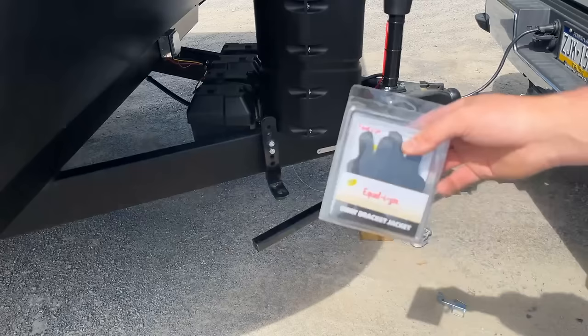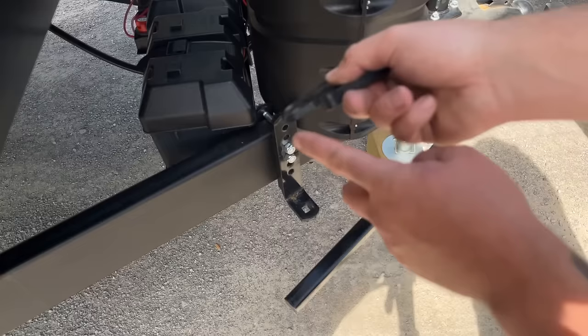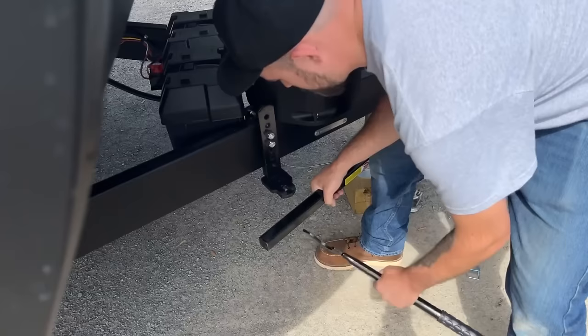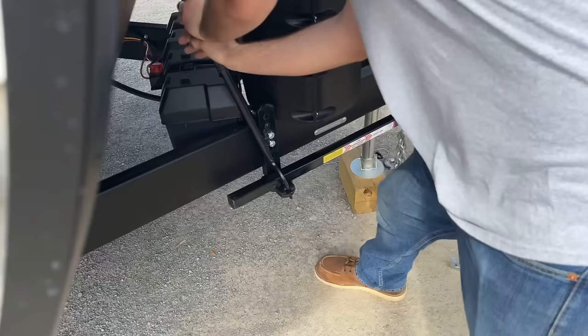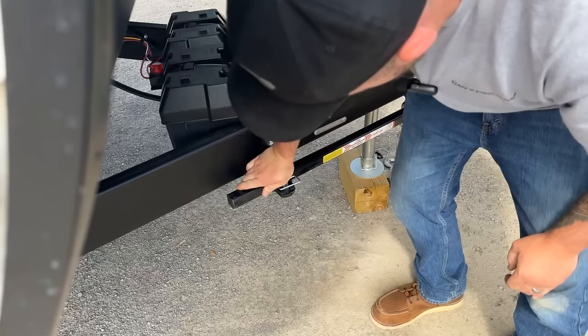If you've ever been around a campground where somebody's pulling a trailer and it makes horrendous noises the whole time, that noise is the friction of this bar sliding over the bracket. That's actually how the hitch works — it's designed to do that — it's just unpleasant. So they made these nylon brackets that fit over the L-bracket to provide a better gliding surface. The way they install is nice: they index with that L-bracket, the front is even ramped to help you get the bar on, and they simply slide right over.